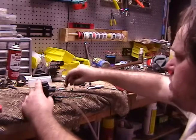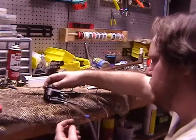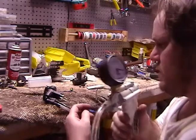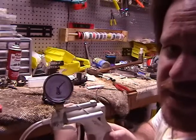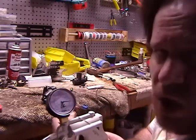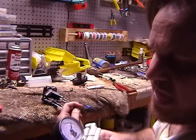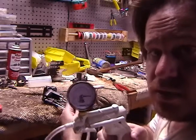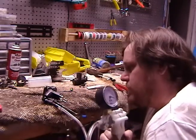Ready - I've activated it. It doesn't hold vacuum, but you only need 8 inches of mercury to get that EGR valve working, and as soon as it hits that it does move down pretty fast. That's what I was seeing on my old one, which is why I thought something was wrong - it wasn't holding like the rest of them.